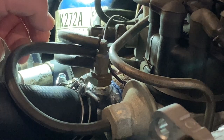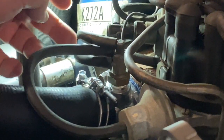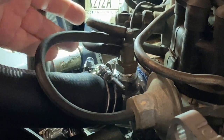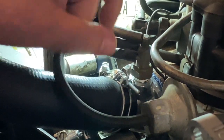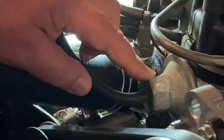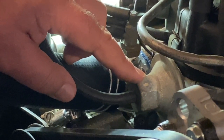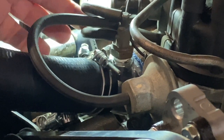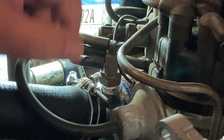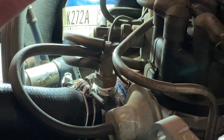The two ways this can be set up for function: either when the engine is cold, intake manifold vacuum is applied to fully advance the ignition timing to help stabilize the idle speed and idle quality when the engine is cool. When the engine warms up, it shuts off the intake manifold vacuum and cuts over to ported vacuum, so vacuum is only applied under light or medium load conditions with the throttle blades being opened.